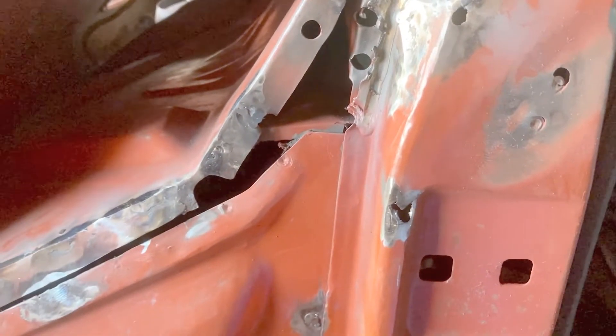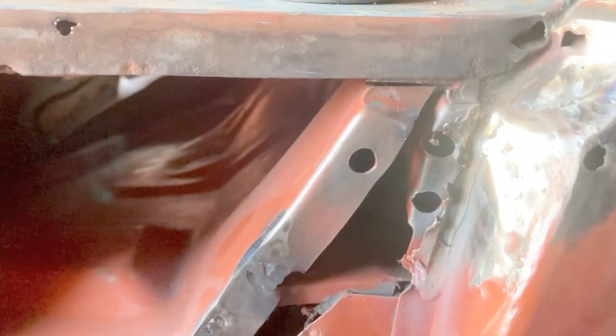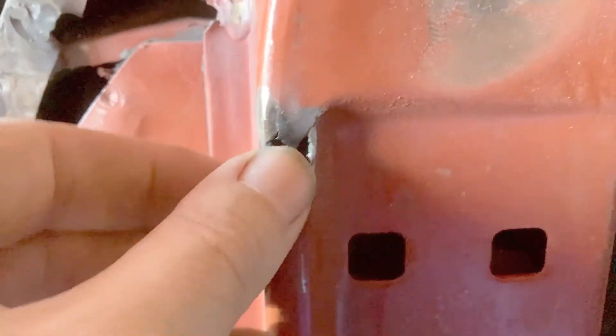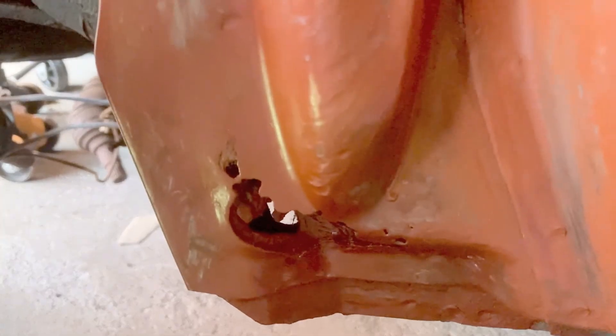She is 42 now so I'm not going to complain too much - it's going okay. I'm going to get some primer on here now. Next time I really do want to do these - I'll have to try and get in behind there with some copper, but the angle is going to be tricky. That one's easy enough, and then there's this which is easy enough too. These holes on this pillar, though - you can't go behind these so they'll all have to be cut out and replaced. The last bit in this area is down there, which I'm not going to look at now.